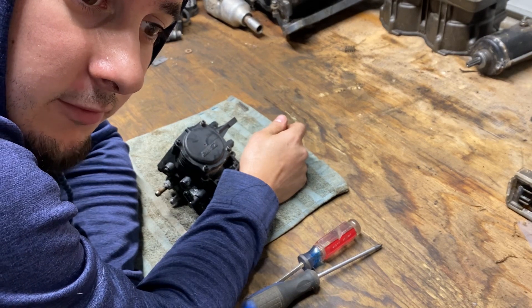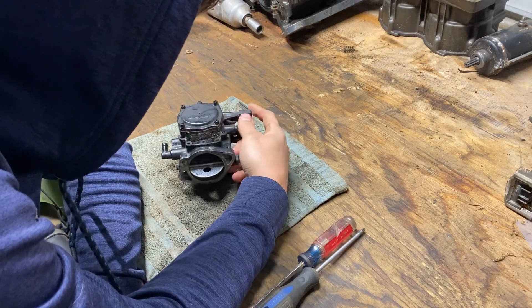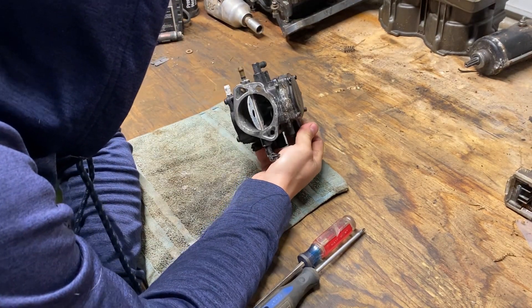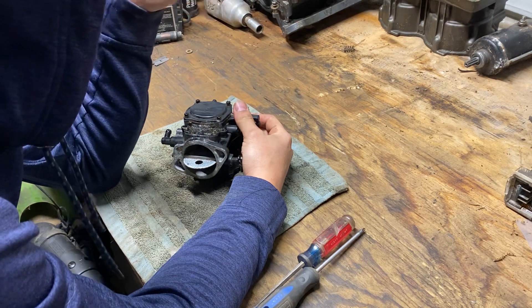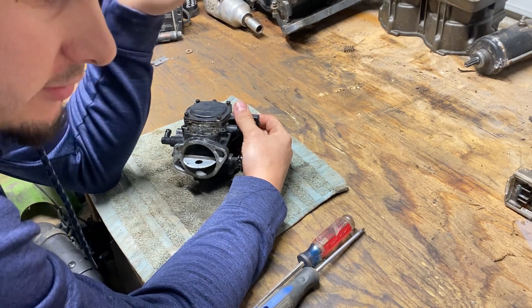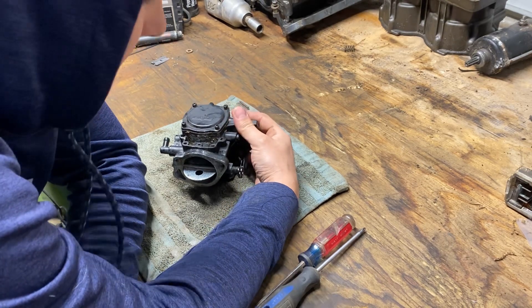Next day after getting the TS running, I've got the carburetor here. It's a Keihin - I don't know how you pronounce it. I'm going to throw a rebuild in it. I actually have my Super Chicken engine right there that I literally rebuilt that Keihin like a week before I took it out. So I'm actually going to use the diaphragm out of there, and I have all the pumps and the rest of the diaphragm rebuild kit in the toolbox still.